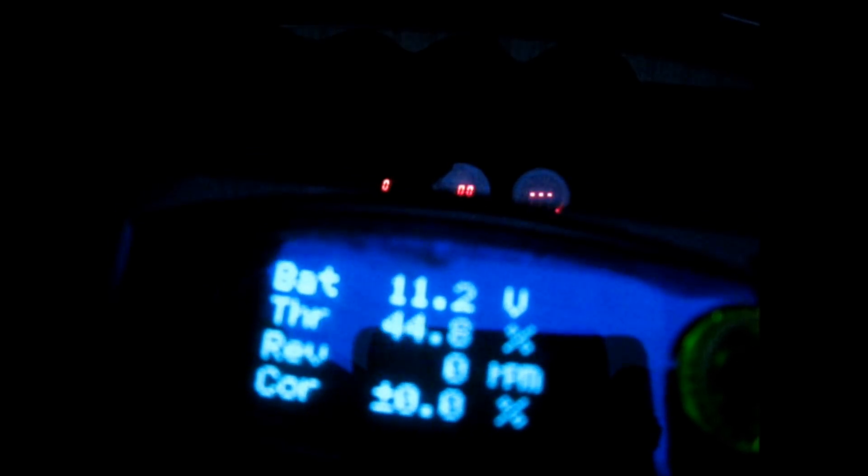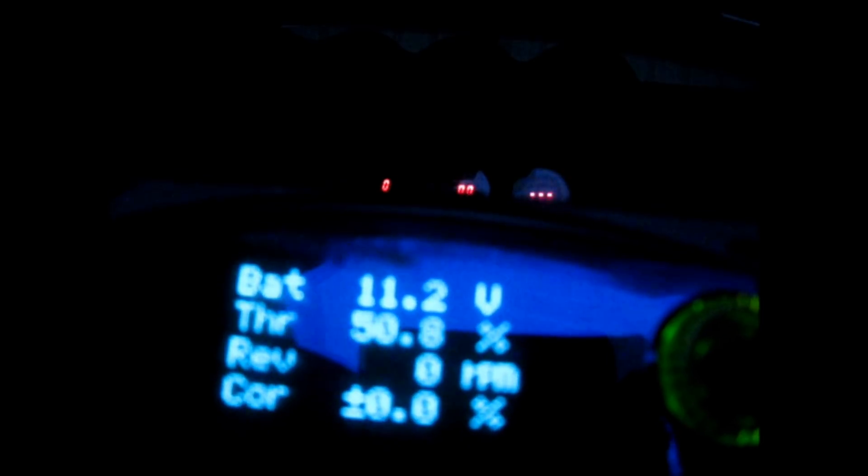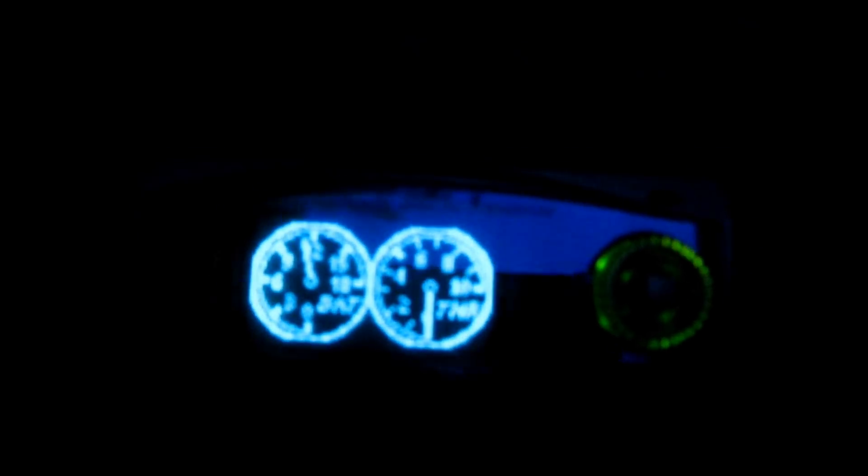On the peak hold screen, hit up to see the peak hold — throttle right now is at 100%. To reset, go right with the arrow and say reset all. Back in normal mode: take the throttle up to 23%, come off, hit up and it shows 23%. Give it a bit more and it shows the new peak hold value — 59%. To reset again just go right with it highlighted. You also have pause: hit left to hold all values so they don't change as you press the throttle, and hit down to reset back to live. Hopefully this is useful — this is part one, thanks for watching.